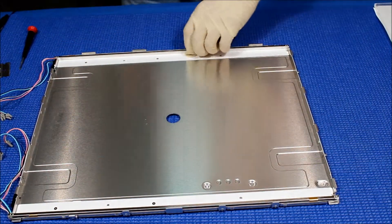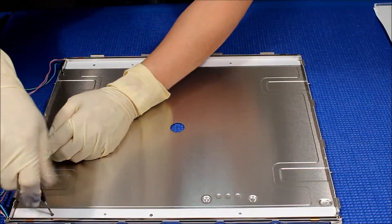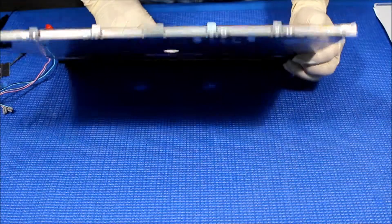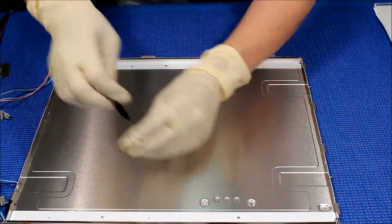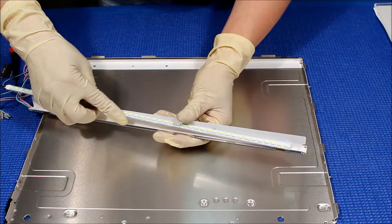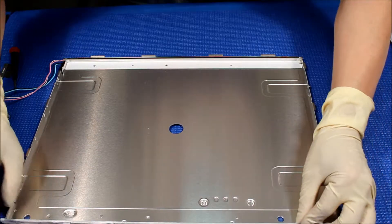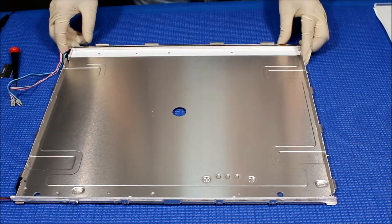There's a small screw that's holding the backlight assembly. Before we move that, I want to show you — it's not going to fit inside the reflector, but I'll show you when I take it out in front so you can see better. This 70 series LED is going to be way too big to fit in here. In that case, we are not going to use the original reflector. We're going to mount it here, and that way we can use the whole back assembly as a heat sink.